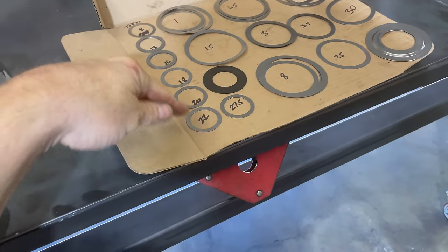The first fit of the carrier, we had no backlash or about one thousandths, which is not enough. We ran a pattern and we're sitting really deep, so we pulled out a shim, which is going to drop the pinion back and move our contact on the ring gear towards the outside — which is where we want it. The pattern looked decent, so if we can get the backlash set, we can move over onto the preload and be cooking.